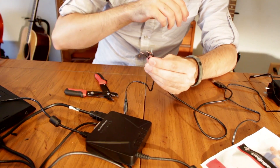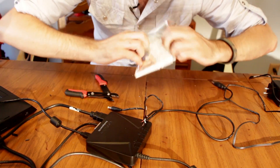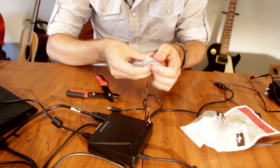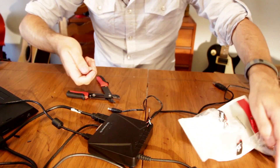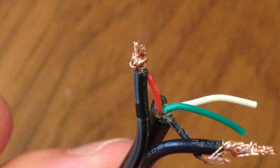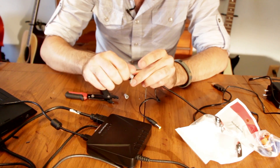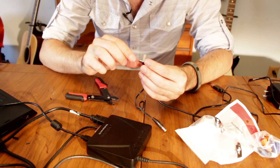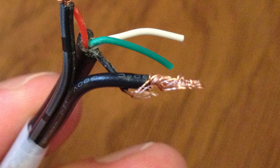We want it to get the positive power. You're also going to need wire nuts from Radio Shack or wherever — they're about $2.50 for a pack, $16 I think for a larger pack. We're just going to grab two of the gray ones because those are about the right size. Again, dashed one to red. If you mess this up it could be bad, but it's very simple so have some confidence. Twist that wire nut on and make sure it gets all the way in there — you'll actually feel it grip. Then do the undashed one, which you can almost think of as a solid black one, to the black cable.